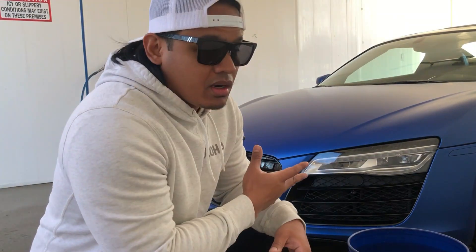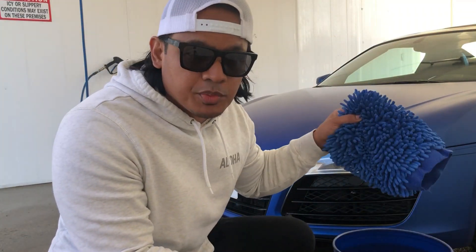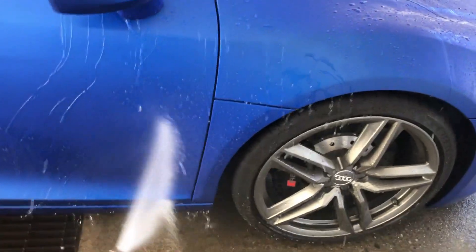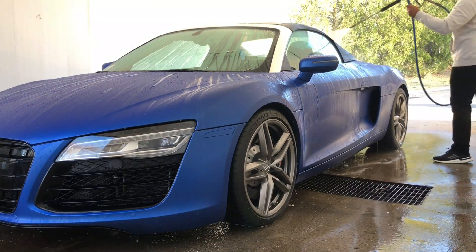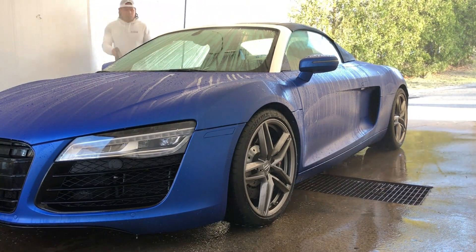Before I get to that, I need to thoroughly wash the car to make sure there's no dirt, no wax, nothing on it, and it's bone dry. To wash a dipped car, it's actually really easy — I'm just going to hose it down to loosen any dirt, then use the two-bucket method with a wash mitt and a mild soap that doesn't have any sealant or waxes, get that all over the car, then rinse it off. I don't need to pressure wash it — just use a low setting to knock off the soap, then dry the car.